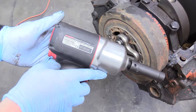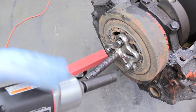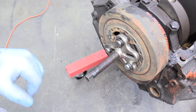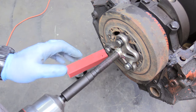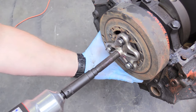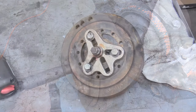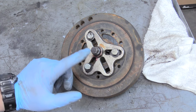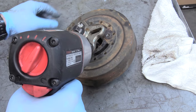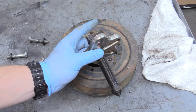We're good here. I'm going to be using my half-inch impact gun loaded with a 9/16ths socket. If you don't have an impact gun, you can try holding the back of the crankshaft — put some bolts at the back and use a big pry bar. But we have an air gun so we're going to use it. You're going to be tightening the center bolt because you're pulling the balancer off. And there you go — we can now remove the puller from the harmonic balancer.